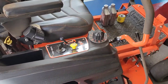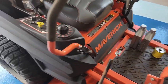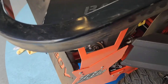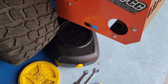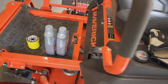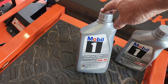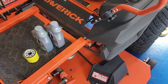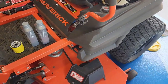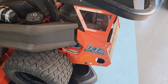I got about four acres that I mow with it and I've been pretty happy with it. Getting ready to do an oil change. There's a couple grease points on it, not too many. The oil is pretty easy to change — there's a filter down here and a tube that sticks down here. You need a 5/8 and 11/16 wrench to do that, and a small filter wrench to drop the filter. What I like to run in these small motors is a Mobil 1 15-50. It's a little hard to get and expensive, but you only run a couple quarts. I run Royal Purple in pretty much everything I have, and some Amsoil in the gears and differentials.